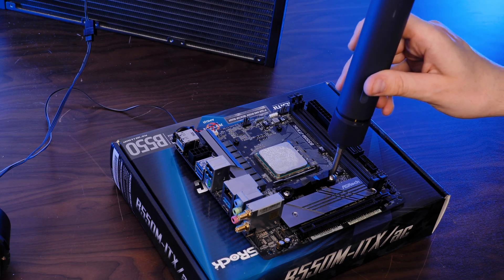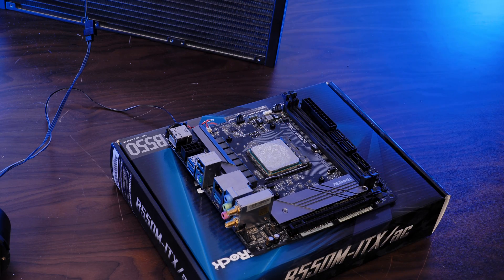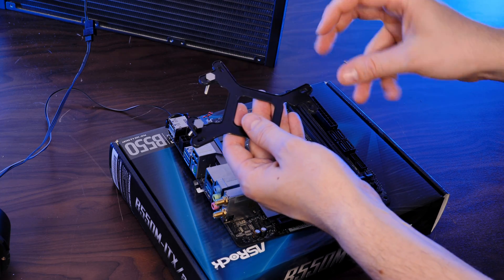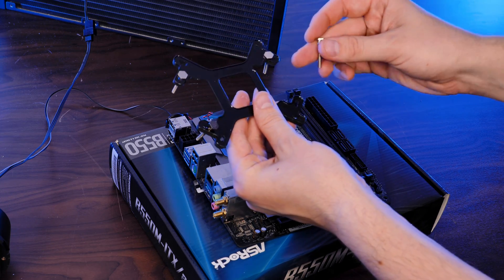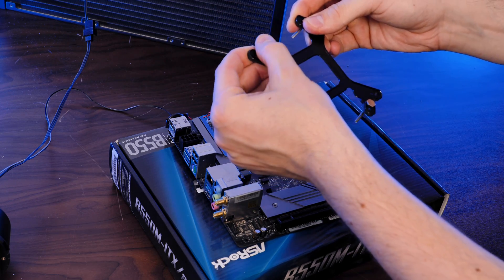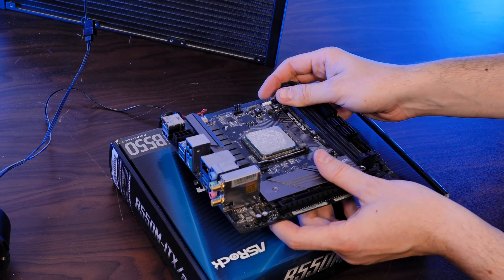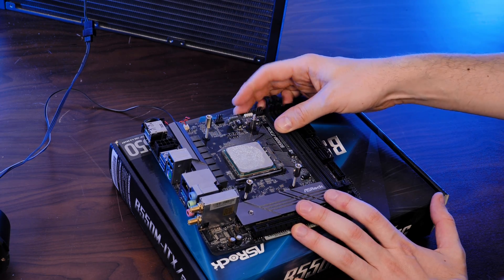Really refreshing. Except for AMD users, who first need to remove the pre-installed brackets and backplate before continuing. From there, everybody needs to take the backplate and position the long screws in the holes according to your socket — with the most outer ones meant for LGA 1366, LGA 1200, and every 1150 variant. In the central area, the most outer ones are for AM4 and the most inner ones for every other AMD socket. With the screws positioned inside the backplate with the edges facing up, place it behind the motherboard, then put a washer on each screw followed by the nut.